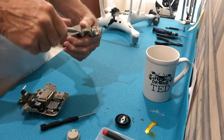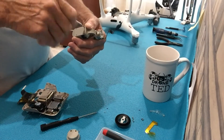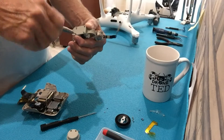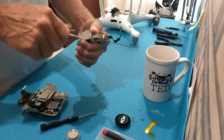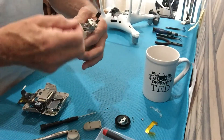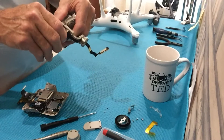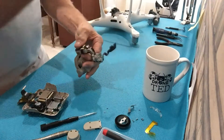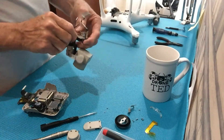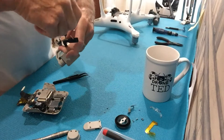I'm going to go through this as quickly as I can so we can get to the yaw motor. Quick for me is not real quick — I'm quite old and have arthritic fingers. The cover that protects the ribbon cable popped right off. You lift the tab on this one carefully, use a pair of tweezers and just kind of pop it out of there. Now we have to take the stop off the top of the yaw motor.